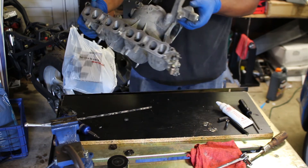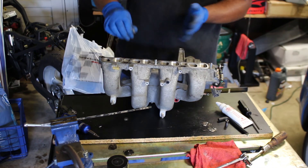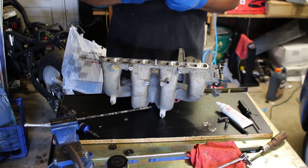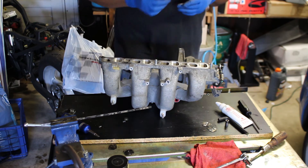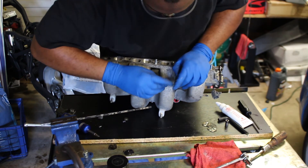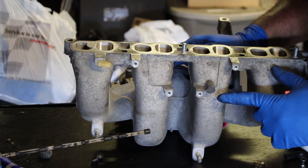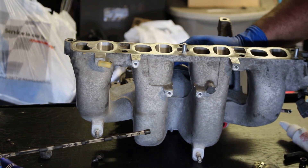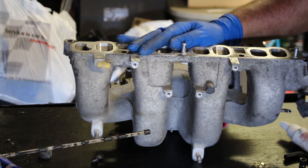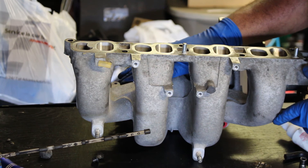The EGR side is sealed up, and the last one is the port on the top. What I have here is some JB Weld putty — just mix it together and use enough to plug the hole. Here is where I've plugged it with the JB Weld; it sets in about five minutes but takes about 24 hours to fully cure. So my intake manifold is clean, the EGR port is blocked off, the VTCS is removed, and all the holes are plugged — this thing is ready to go back on the car.